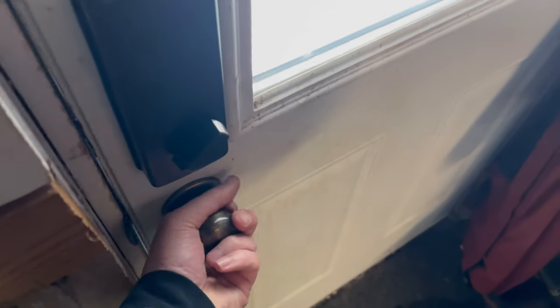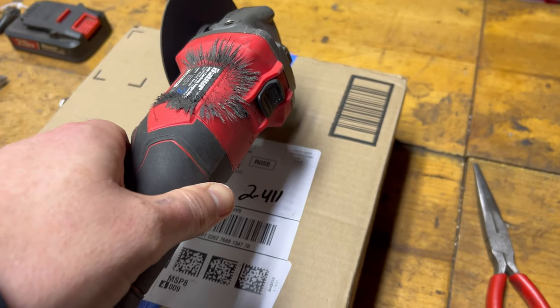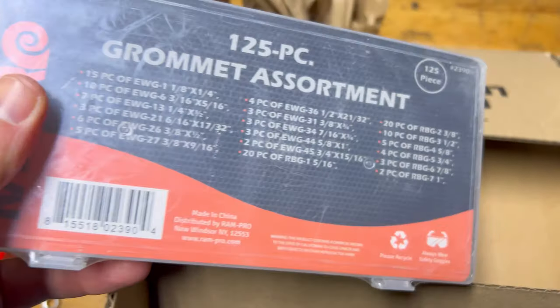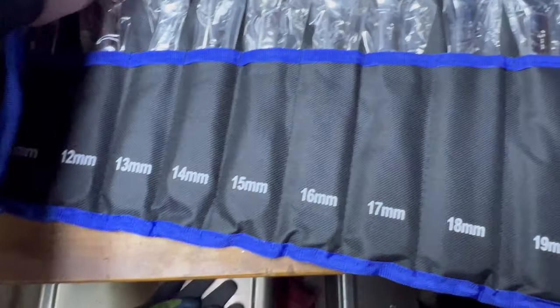Well, the mailman just arrived. We needed to order a special tool to get that winch mounted on that front bumper. Let's see if what we ordered has arrived. The front bolts on that winch on that bumper are so close to the inner bumper, I needed to order a ratchet wrench, 13 millimeter, with the flex head on it. Let's see if that is the ticket.